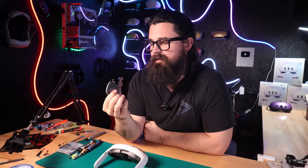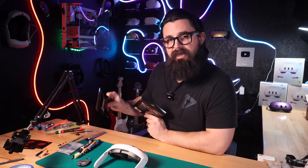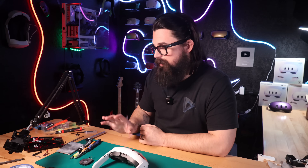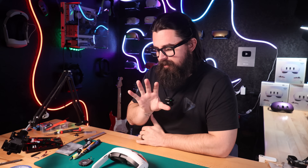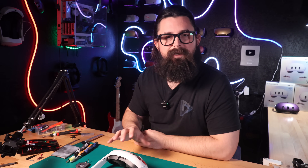Regardless, I'm probably going to go ahead and replace the fan for him. It's a pretty easy repair and he plays on it a lot. I'm also going to add some new thermal pads and new thermal paste to help with the overall heat dispersion. It's not going to make a huge difference for the average user, but for somebody who's using their headset a lot or has overclocked their Quest using SideQuest, every little bit counts. We'll clean everything out and make sure there's no underlying dust, debris, or loose screws in the fan.